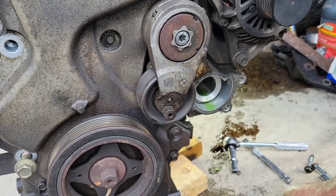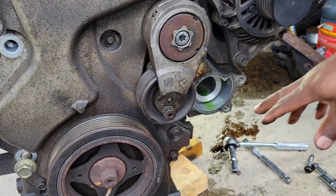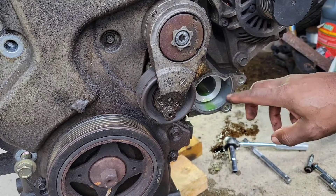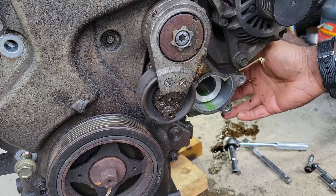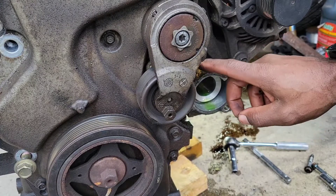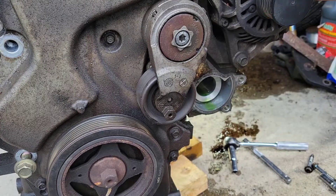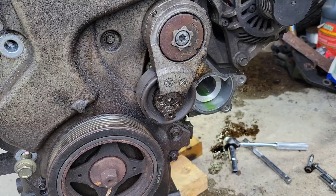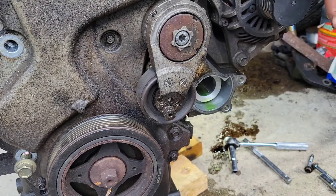If this helped you out any kind of way, like and subscribe. When you take the bolts out in the front, you might want to leave one on because the back one is kind of tricky to get out, so you might want to do those first before you do the front ones. Once you move the belt, you may have to remove the alternator — that's pretty simple, just remove these two bolts here, remove the alternator and the belt, but the belt will already be off.